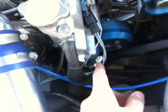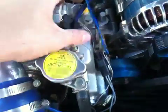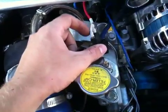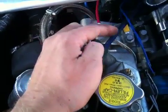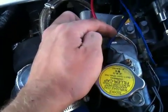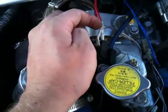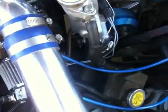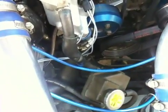What powers the solenoid — going over here — you've got those same two power lines. Ground and 12 volts is what you're getting to. Ignore that line for a second. What I've done is grounded it, and my power has 12 volts coming in. This little relay is based on boost pressure — it's 8 psi for my system. When this line reaches 8 psi, it allows these two lines to connect, giving it power, going back through here, and allowing water to go through. That's how simple this water injection system is, and I'll update you guys when I get it all working.